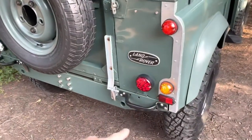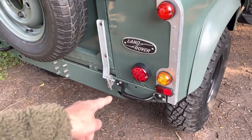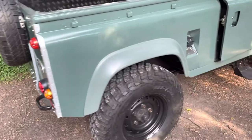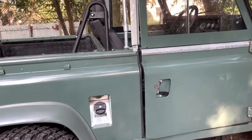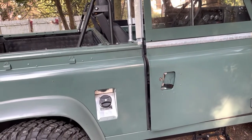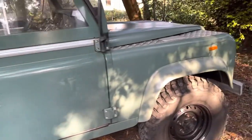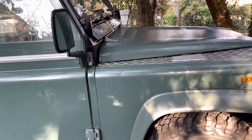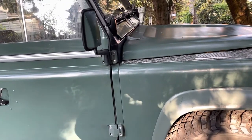So everything else is looking pretty good. I've got a new handle to put on there because I bashed into a recovery truck and that's bent the handle, so I've got a new handle to put on there. And then that's all for now. Squeaky fan belt still to do — I think the pulley's gone because I've tightened the fan belt and it's still squeaking on start-up. So that means a new pulley. All right, that's it. Mark out.